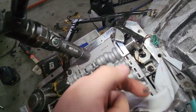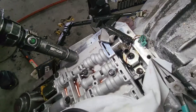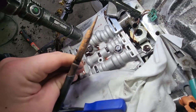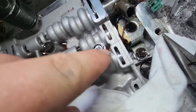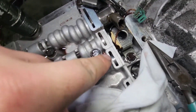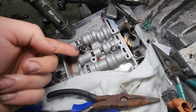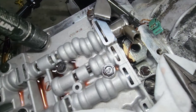You can't push them through to get the pin out — as you can see, it doesn't go through on here. What you can do to get it out is take a pair of needle nose pliers and grind them so they fit down in here. You take the little pins on the end of the valve and bend them straight. Then you take the pliers and finagle it, coming in with picks to push the valve until you get the clips to pop past the lip.